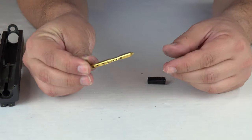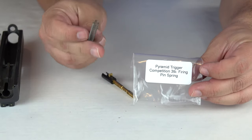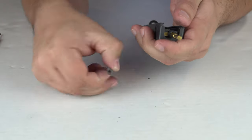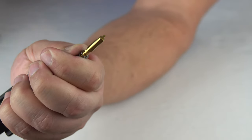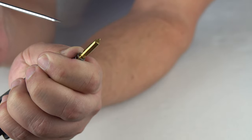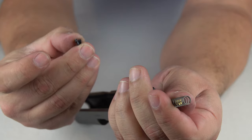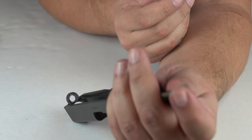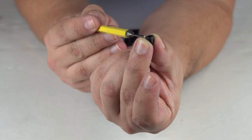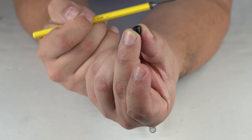And this is our old firing pin. We have our new skeletonized striker here and we're going to put the spacer sleeve around it back the same way it was on the other one. I'm going to use a three pound firing spring. We're going to use the slide to help us, place this back in, turn it, and put the spring on. There's a lip right here so you need to pull that spring down past that lip because that's where we're going to put the spring caps on. You do not want the gap at the end of the spring to intersect with where the two caps meet, because the end of that spring could work itself in there.